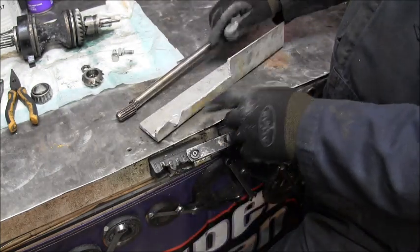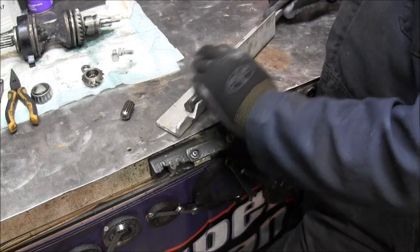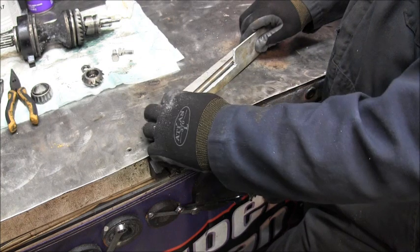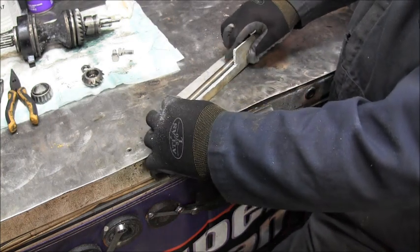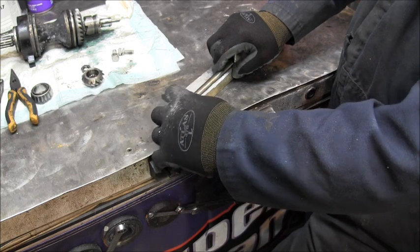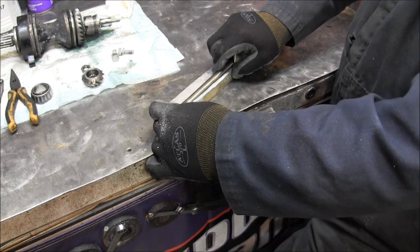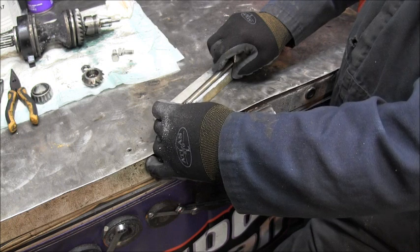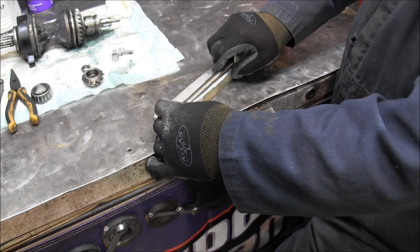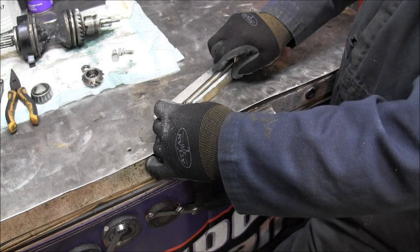So then you see that little cutout, that little V-notch. I'll take my drive shaft and center it over that V-notch. Then I'll take where it snapped. That'll all be clamped in there real good with vice grips and C-clamps, whatever. And then I will grind a trough through all that. Then I will weld it and fill in that trough. And it's important that you cut a bevel in that and get a lot of good steel in the break.